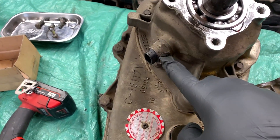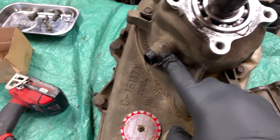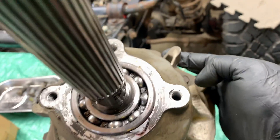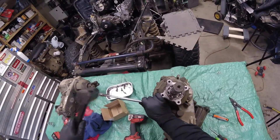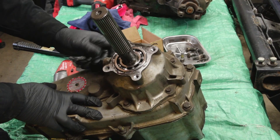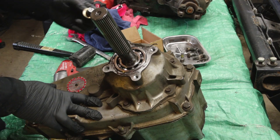We need to remove the speed sensor — that's how your speedometer gets a signal to see how fast you're going. That's a one-inch socket; use a one-inch wrench to remove that. Remove the bolts that go around it, you can pry there, tap it, and you'll be able to get that cover off. Tap this lightly, move the sensor — there you go.